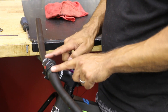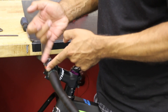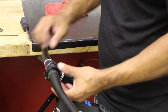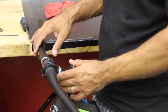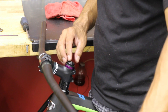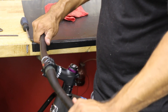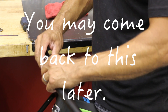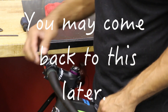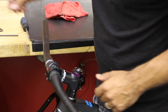Some systems are easier to line up the bars. Again, these go back towards me with no rise — this is considered a flat bar, pretty common for cross-country racing. I'm looking at the lines on both sides — either a little hair is showing on each side or it's completely not showing. Then we get our tilt angle correct. If you need to, get off your bike, stand back, get eye level at your handlebar and look straight across to make sure the angle isn't too high or too low. Once everything is buttoned up, you can still loosen the faceplate bolts slightly and do your tilting.